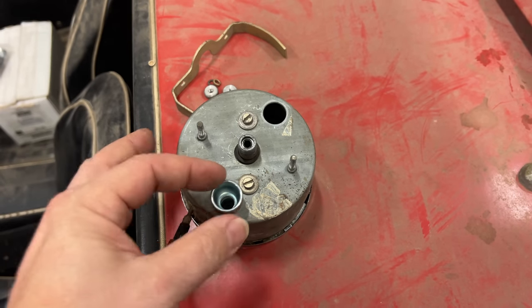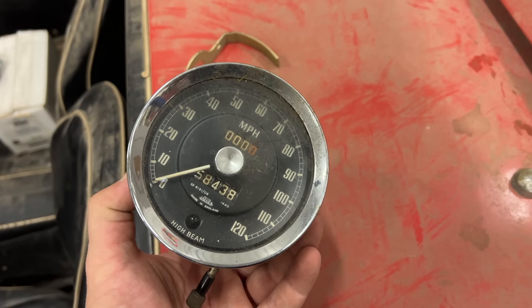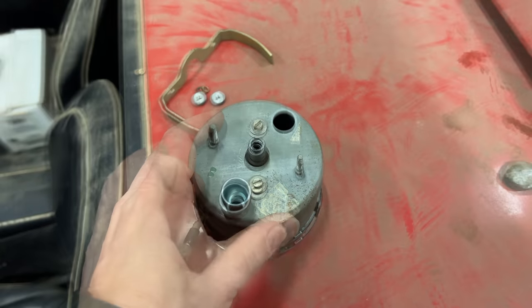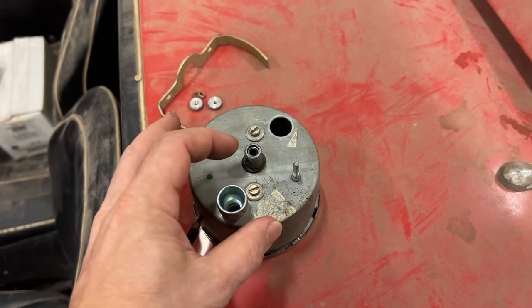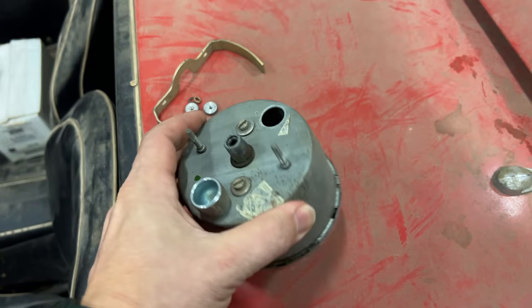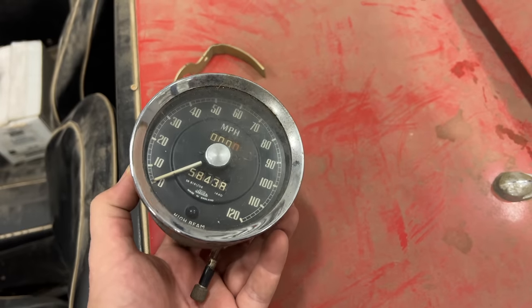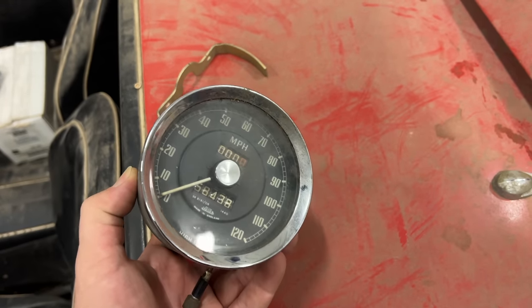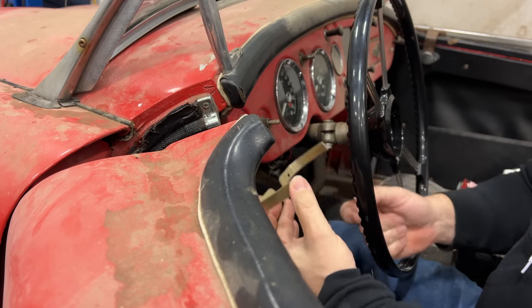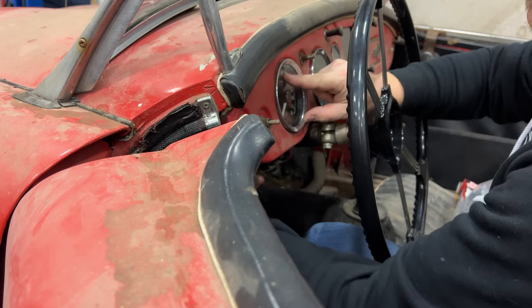You'll have a cable that goes into the back of it that you need to unscrew, and the light for backlighting just pops right off. Of course, if you have a gauge that is run by electrics instead of cable or a water tube, you can pop the gauge out of the dashboard and that usually gives you really good access to removing the electrical connections. Then you can pop it out and send it off to be rebuilt or take it apart yourself. To put these clamps on, you could crawl under the dashboard, but usually I just do it by feel.